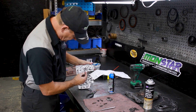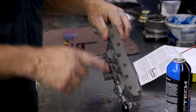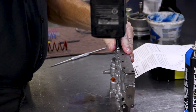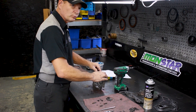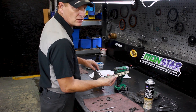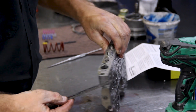Following the instructions, you're going to remove this long plate — same 5/16 size as before. All the screws are the same length except for the one in the center. There is a little bit of spring tension on it from the springs and valve pushing against the plate, so make sure you hold pressure on it so it doesn't spring off and you lose your parts. If you notice, there are oil channels on the back side of this plate to move oil to the next valve assembly through the plate as well as through the channels on the actual casting.